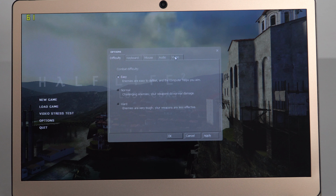So best of luck with your own tweaking of the power limits here. And I really hope that manufacturers out of China, like Chuwi and the T-Bao Air, start to give us that option in the BIOS, the power limits. Let us change that. If you do have a good copper heatsink on there, I see no reason why not to do this tweak for those that want maximum performance.